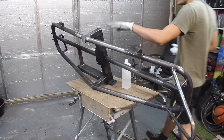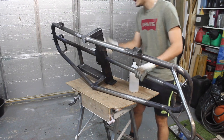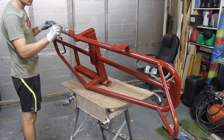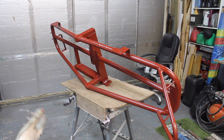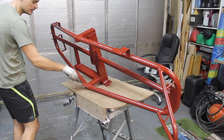I'm just going to give it a quick clean up with some isopropyl alcohol — it's like a panel wipe, just rubbing alcohol. And that's the first coat of red oxide primer down. I'm going to let that dry and then give it a second coat before the top coat of chassis paint.